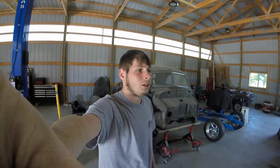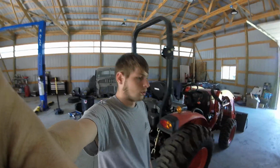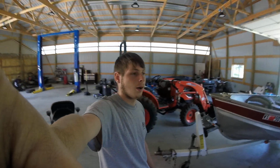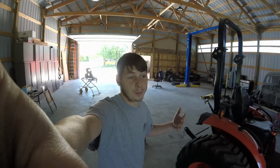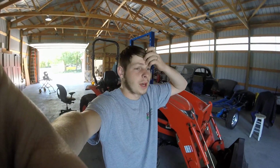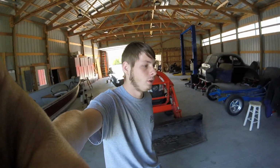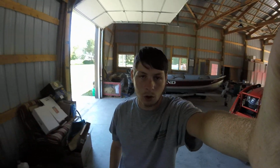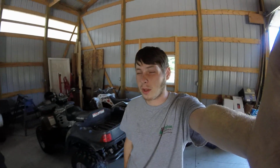That 350, I'm not exactly sure. The guy said it has a cam and some heads and stuff like that, headers, intake, the basic runaround. So it might be a good candidate for boost, might be a good candidate for nitrous. Really don't know. If I do nitrous, I'm not going to go big. I'm just going to do like a 50 shot, something safe. I just want to be able to drive it down the street and stuff like that. So I don't want to go too crazy. But if I do a turbo, I'll probably try to run about 10 pounds of boost on it.